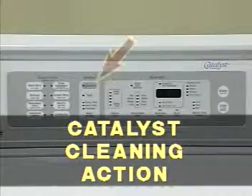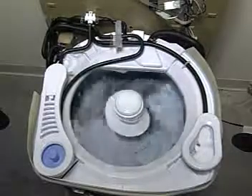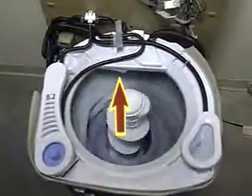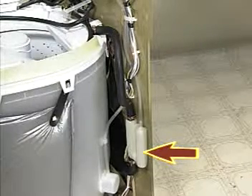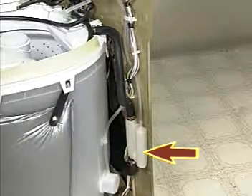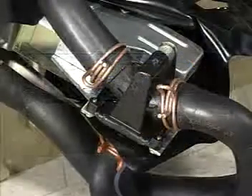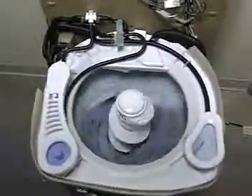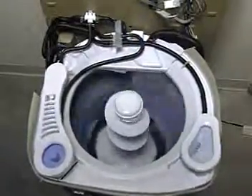Catalyst cleaning action can be selected as an option in any wash cycle. When catalyst cleaning action has been selected, the basket immediately begins to spin the dry clothes and fresh water enters through the detergent dispenser. A specially designed extension of the tub ring pushes the dry clothes downward. When a sufficient level of the water and detergent mixture has entered the tub, the recirculation pressure dome, located on the right side of the feature panel, causes the recirculation pressure switch to trip. The water and detergent mixture is sent through the diverter valve to the recirculation inlet in the tub ring, where it is then sprayed onto the spinning clothes, saturating the load.